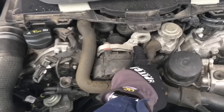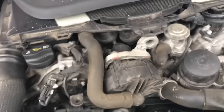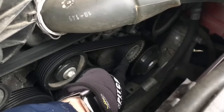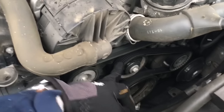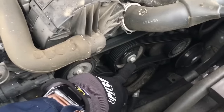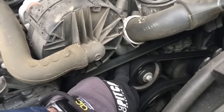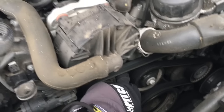I'm going to start off by taking off this air pump, which looks like it's just a couple of Torx T30s — one top, one bottom. Then we're going to go for the main belt tensioner right there, which looks like another Torx T30, and take the old belt off. Then I'm going to go for this bolt right here which holds an idler on. The main reason we're taking that off is because it's in the way of one of the two access holes for our thermostat housing.